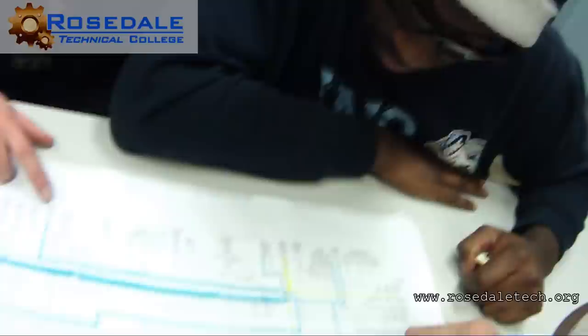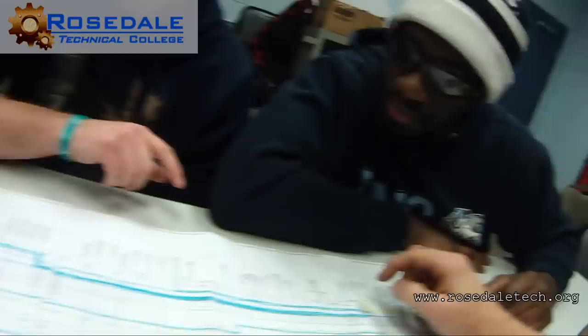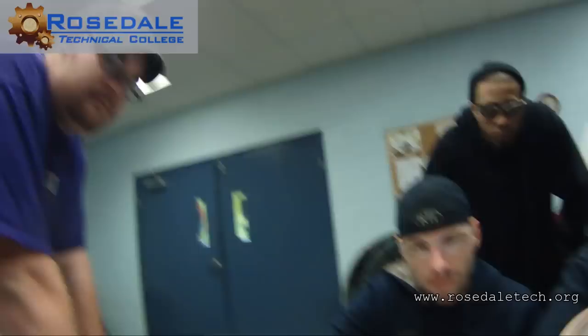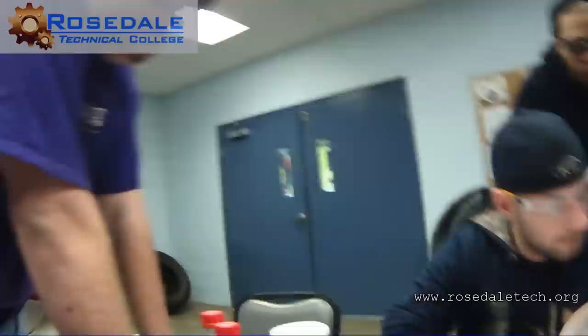As long as the coils aren't on this circuit, what's that? Ignition coil top center. Darn it. I thought these were the coils. They're not. Those are shift solenoids. The ignition coils are on this circuit. So here's the thing. What I wanted to do is take this fuse out, put a jumper where the fuse is, and put the amp probe around there. Problem is, if I do that, the coils are going to be firing at the same time as the injectors, and it's going to be a muddy picture. That's not going to be the way we want to do this.